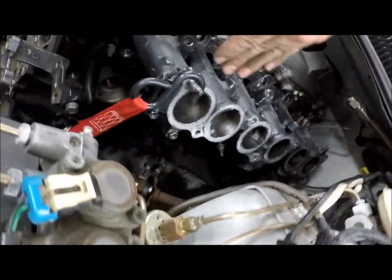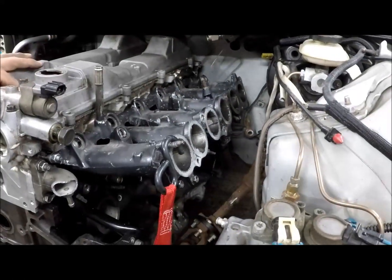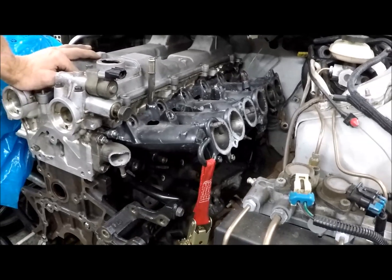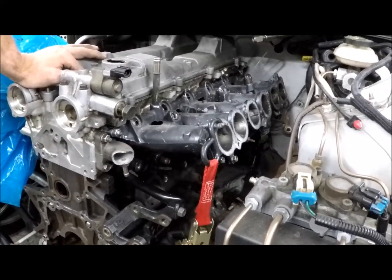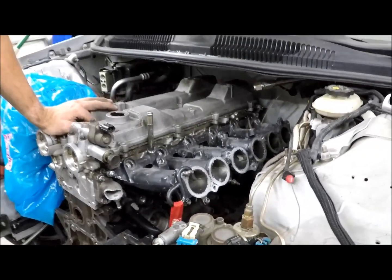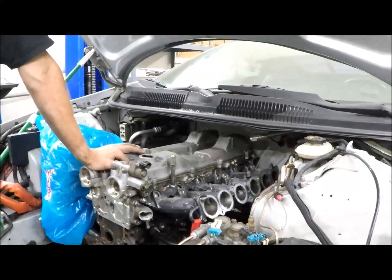That'll allow me to take it in from basically the inside of the intake manifold, and then we can take some cartridge rolls and smooth that transition so that it's as nice and smooth as reasonably possible. And then we'll basically build out the rest of the intake manifold out of some 1/4-inch plate and some 1/4-inch, probably 4-inch tubing. Very nice.